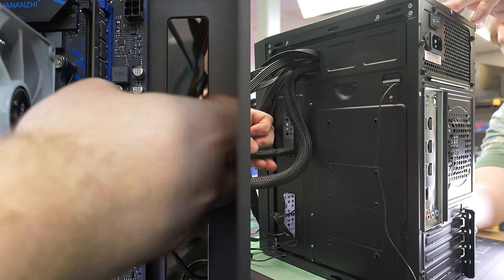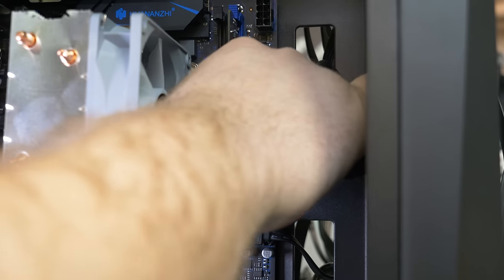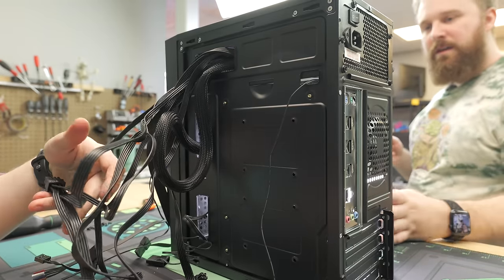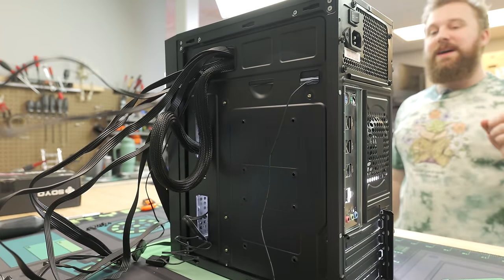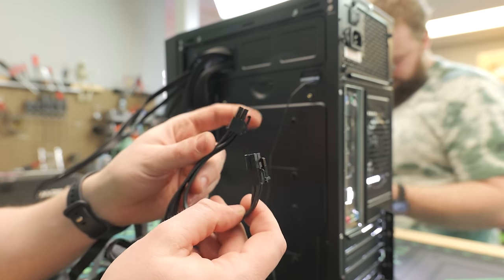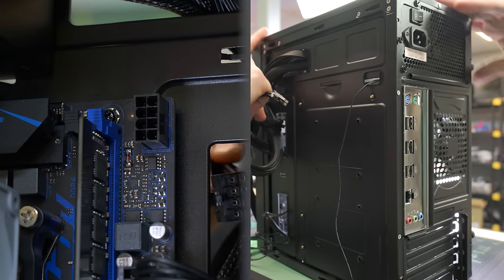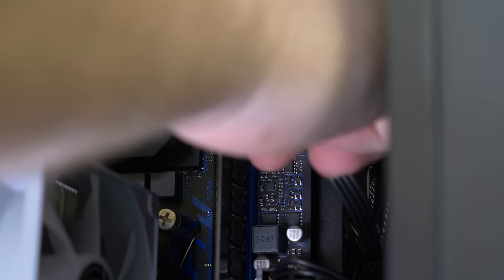Here's our 24-pin right here. We'll flip it, line it up, click, and that's the 24-pin installed. Next is the CPU power — this board has an 8-pin plus a 4-pin, so basically an 8-plus-4-pin configuration. The CPU 8-pin on this board is in a weird location on the side rather than up top. These Xeon boards tend to have CPU power in weird locations, but in this situation it actually worked out really well.